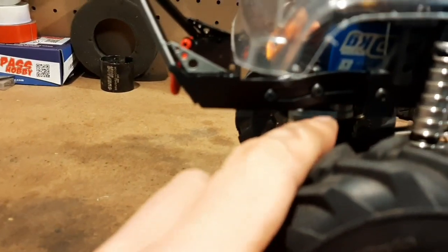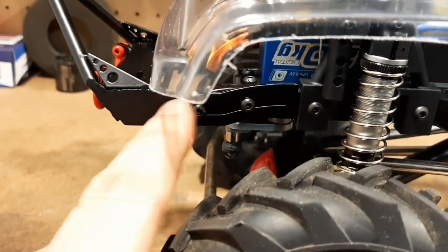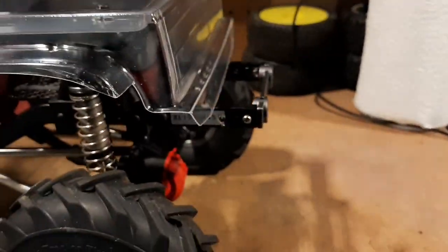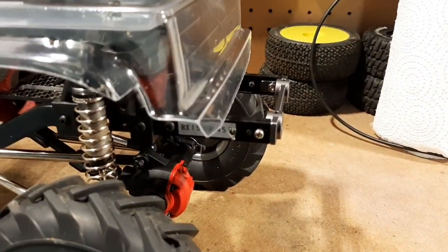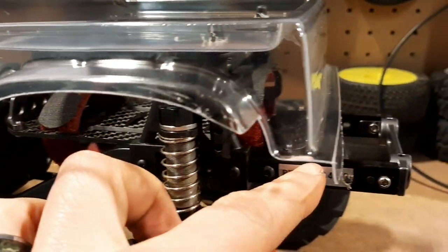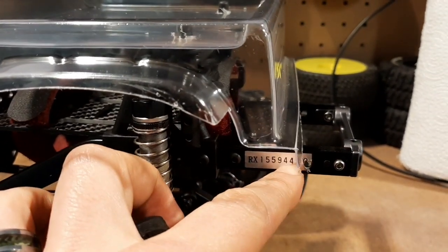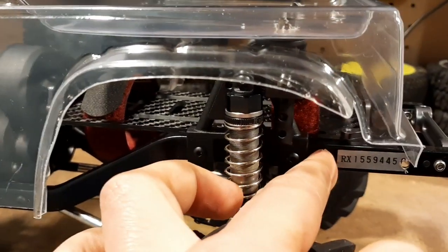We're gonna have to sort of remove that section so it can slide back more, re-drill that hole further along. That will tuck in nicely. And the rear, now it was always the plan to bobtail the rear. From that point onwards, there's nothing but a bit of metal to hold the bumper, and it's pointless, it gets hung up. So that's obviously going to now get cut back there by the battery tray.